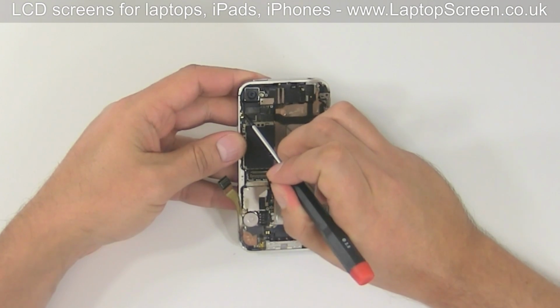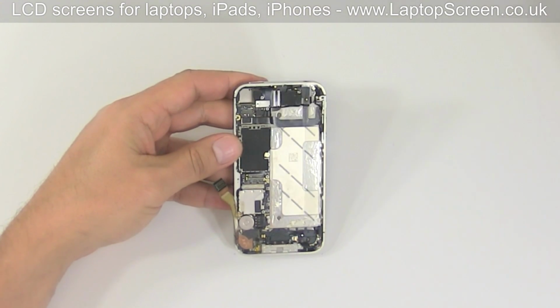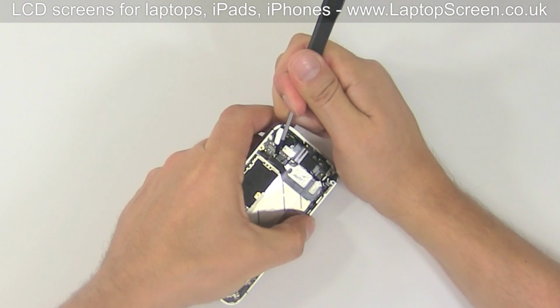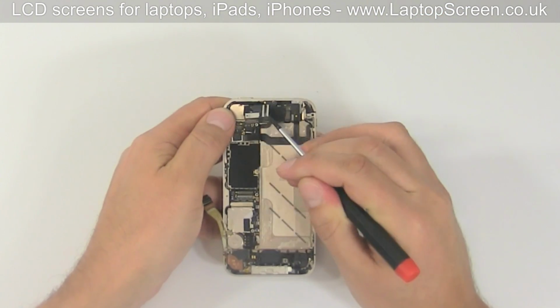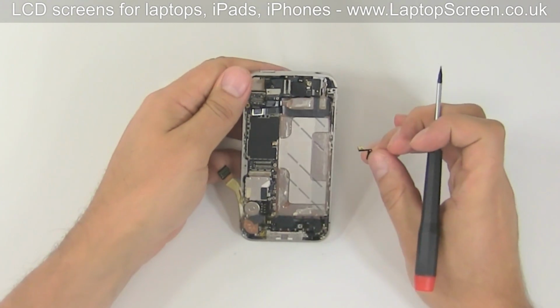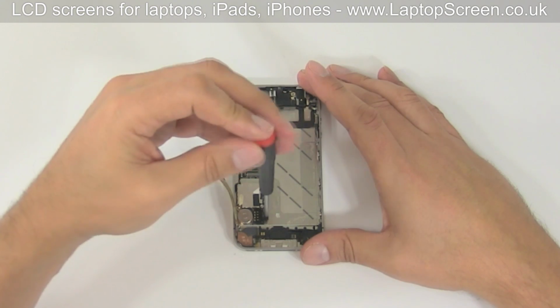Remove the rear-facing camera by gently picking the camera's connector off the logic board. Then pick open another 5 connectors from the logic board. Remove another grounding piece which is covering the cellular antenna connector. Proceed on removing the logic board screws.